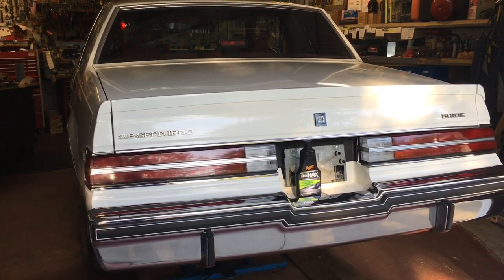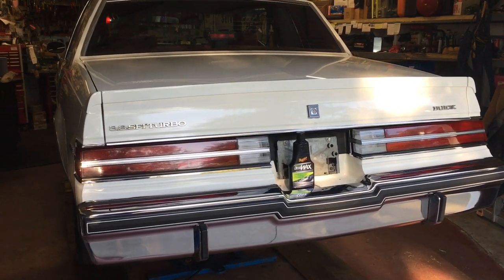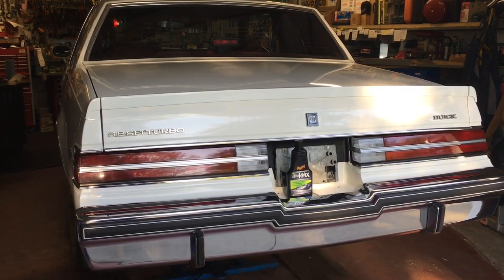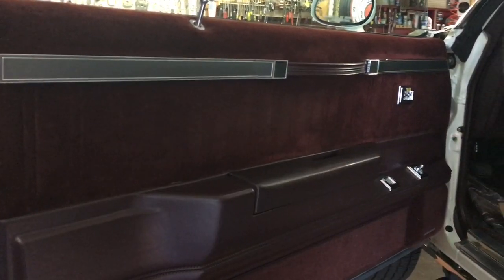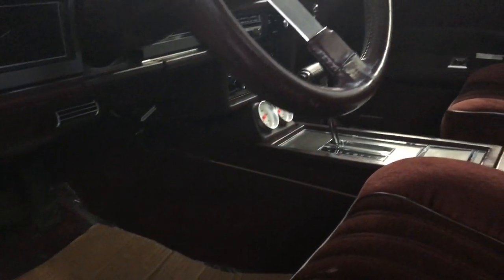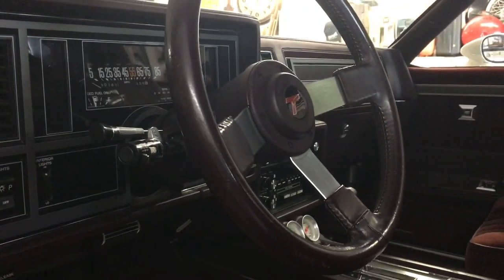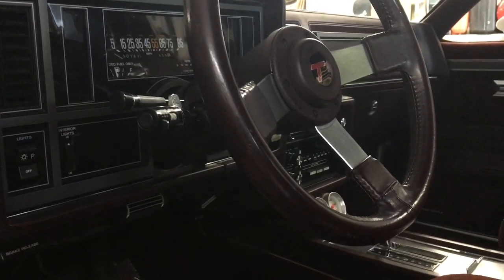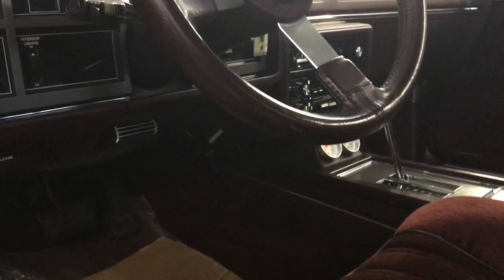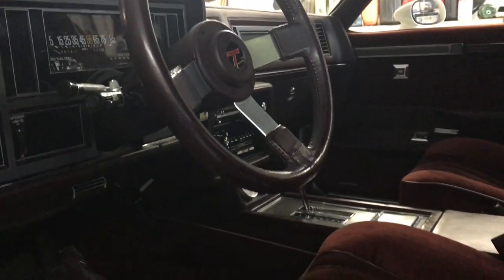They were still a nice look — I'm talking about the T-type Centuries. We had a pace car back in '76. It was fun to watch it evolve. We had a stall diagnostics protocol for these 3-liters and 3.8-liters — mostly in the Pontiac lineup were the 3-liters. Aside from all the mechanical and oil pressure problems, that particular bulletin would outline replacing a crank sensor with a newly designed sensor, replacing the PROM and exchanging it with one that would remap the fuel and modify the spark tables, reschedule the torque converter to a higher apply rate, and just try to fatten up and enhance drivability a little bit. It helped.